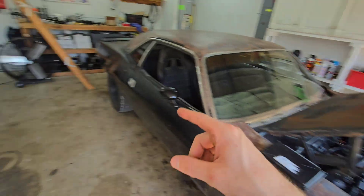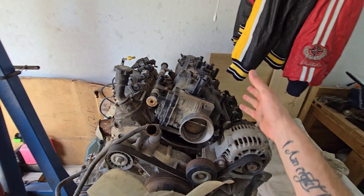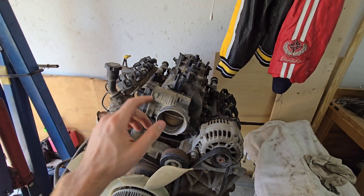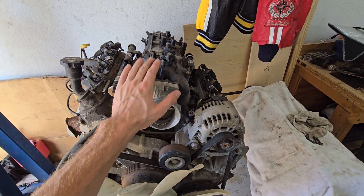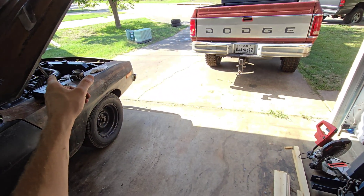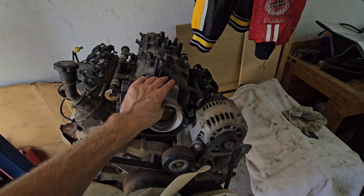The pros and cons: the con of drive-by-wire is the complexity; the pro of drive-by-cable is simplicity. But if you want cruise control or perfect throttle response, drive-by-wire is what you want. You get into that box, set it all up, and with a tuner who knows what they're doing you can get crisp throttle response — even better than drive-by-cable, which requires perfect cable adjustment.